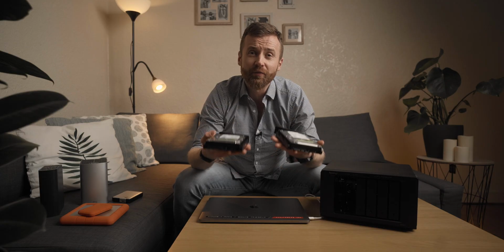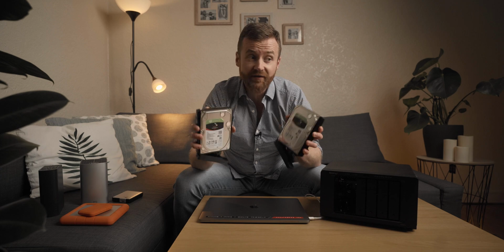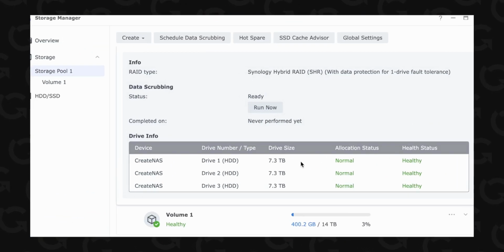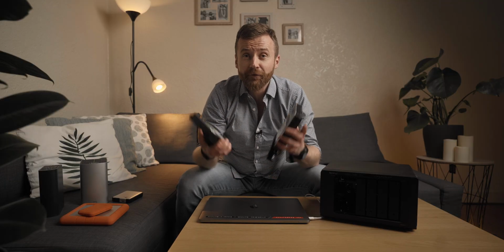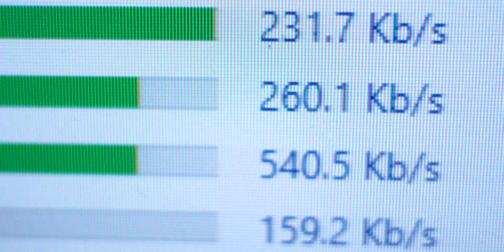The biggest issue with the RAID itself is once we set our drives, in our case it's 3 instead of 6 because we decided to invest in 3 to start with, and we would like to add later on another 3 disks, we'll have to format them to set all those 6 disks together. So if you had some data, we have to move it, reformat the whole system, and then bring the data back.